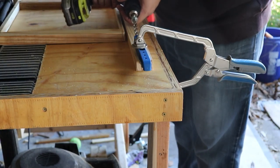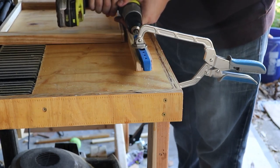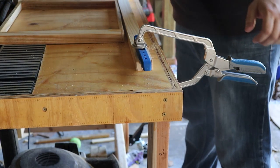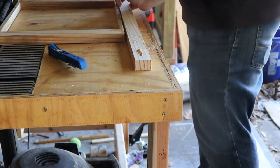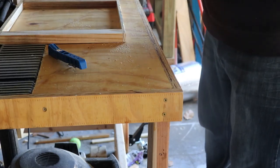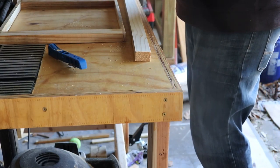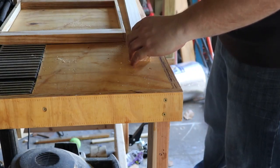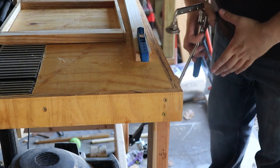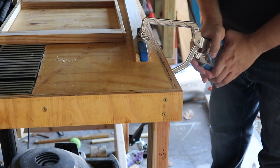So yeah, this is what I was talking about earlier. I had a sagging spar that I installed at the beginning of the project. Unfortunately, even with a cover and a tarp on the camper, the moisture and humidity still ruined some of those, so I ended up having to replace them with fresh wood, same as I've been using, 1 inch by 1.5 inch, with pocket hole joinery, and then remounted it.